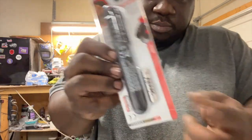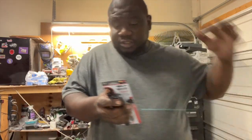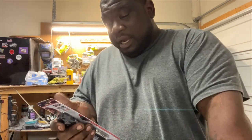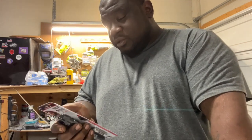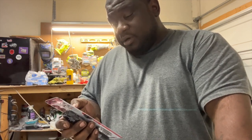So it includes the battery, and you got your fluid tester. 5 LED readouts indicate percentage of moisture. It is calibrated for DOT 4, can be used on DOT 3 but for estimates only, not for use in DOT 5 brake fluid. Access the reservoir, remove the cap of the brake fluid tester, press the button to power on the device.